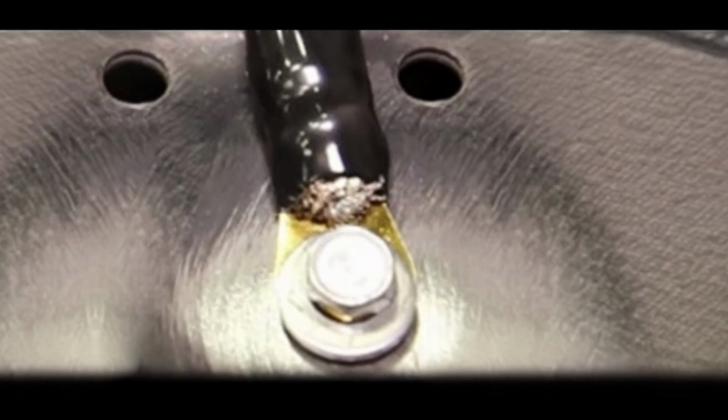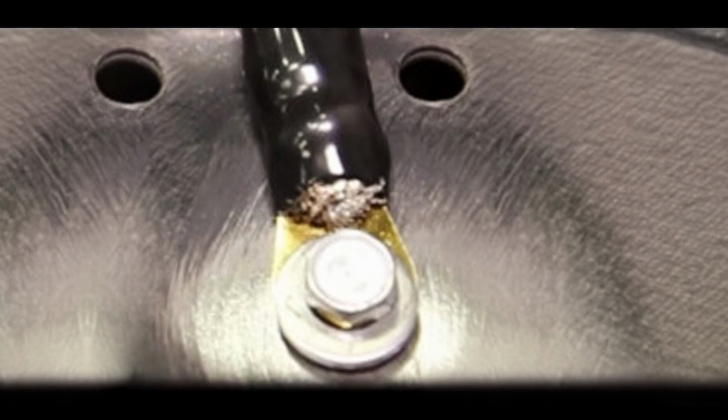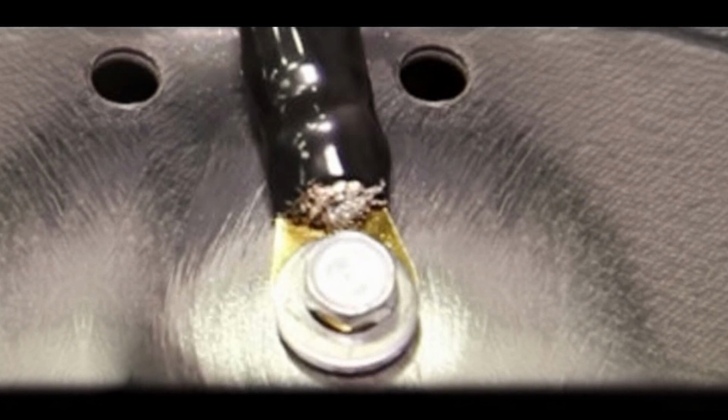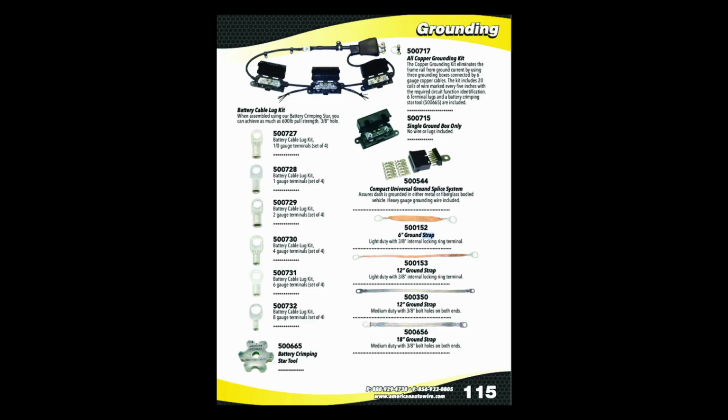Often, all that is required to remedy this unintended insulation of electrical components is sanding the mating surfaces for the newly painted or powder-coated items. Additional, supplementary, ground straps and ground wires can also be installed to bypass the painted surfaces.